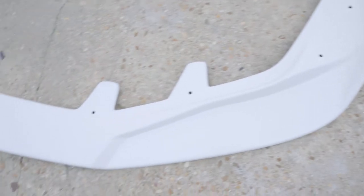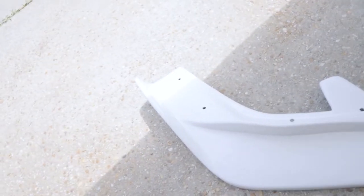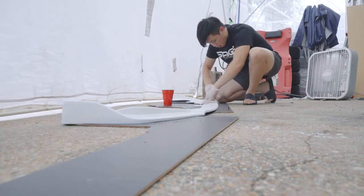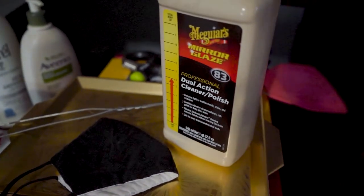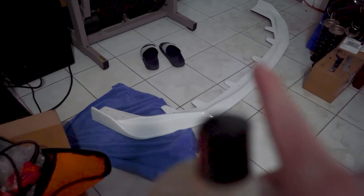After a few days, this is how it looks — it's not as shiny as I want it to be, but it is a spare lip. In the sun it looks really bright. It's okay, not the best job, but it's a spare lip. So I'm gonna wet sand it down to about 1500 grit and then polish it. Back inside — nothing beats the comfort of home and AC. I'll do about a one to two pass polish using Meguiar's compound and finishing it off with Meguiar's polish. I want to wax it, but you're not supposed to until like a month or two after you paint it.